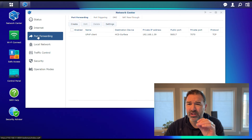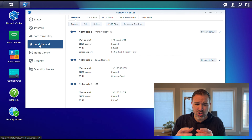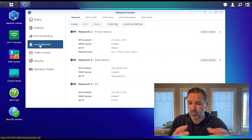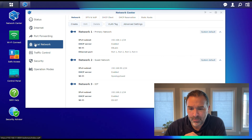Gamers, there's port forwarding built in. The port forwarding rules are very easy to set up, just like in a typical router. The Local Network is where you create your VLANs — where you go and tag ports on the actual switch on the router itself, or apply VLAN rules. This is where you go to create the networks, which is really kind of cool. Set up your DHCP scopes and all that good stuff.